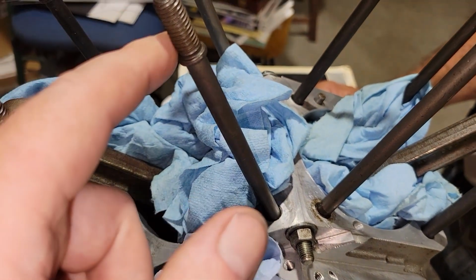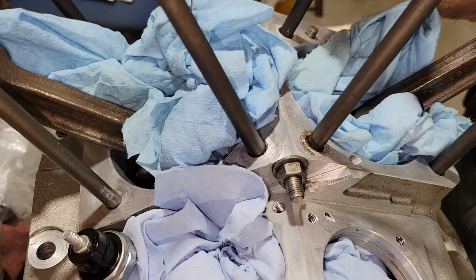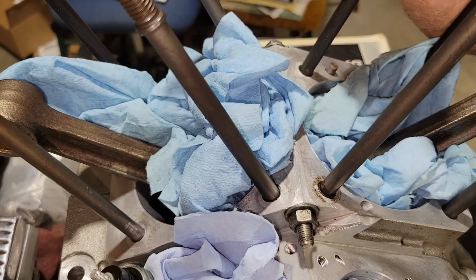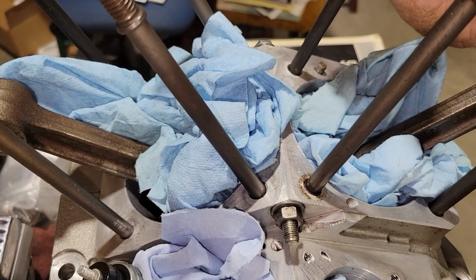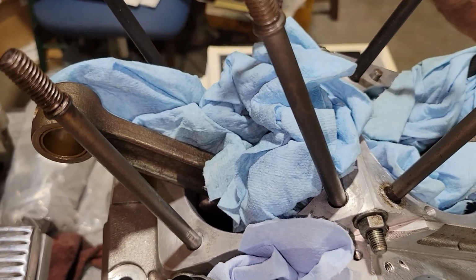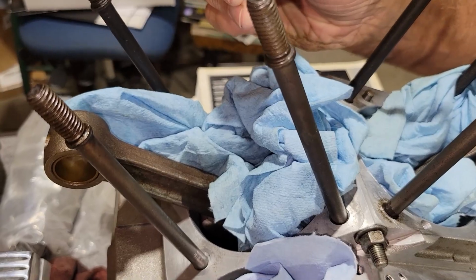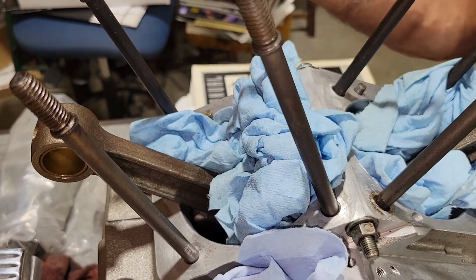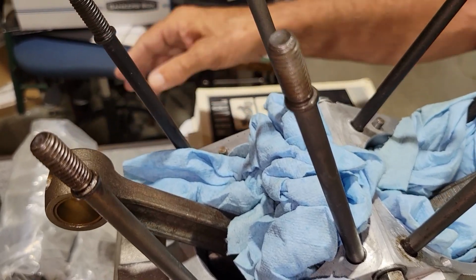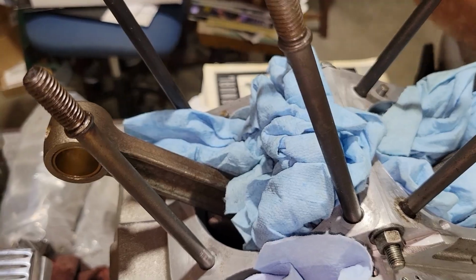And for that, there's a real good reason, because base gaskets always leaked in these motors, and they didn't really know why, in a way, right? Right. They gave you reasons like let them warm up and things like that. And then in about late 94, 95, when this change came about and the service bulletin came out, they really didn't make that widely known. So those motors, the base gaskets never leaked. It's mainly because of these nuts. Yeah, so the 95 through 99 Evos didn't really leak.